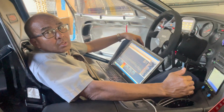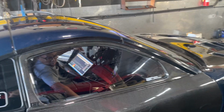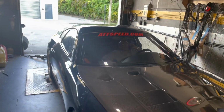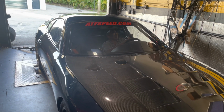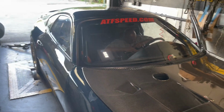Yeah, this big turbo is going to take some RPM to spool for sure. Before, our hardest launch previously on the 8685 was 4,700 RPMs. Car on a 150 shot was like at 18 pounds of boost, and I got a 1.17 or 1.16 to the 60 foot. So now that was 5,100 RPMs, a couple hundred more than we've ever tried, and it only made 10 pounds of boost. But he also wasn't on it very long. That was very instant. I'm sure if you leave it in there banging and popping, it'll make a couple more pounds. But when we get to the track, I'll test it. The weather's also going to be a lot cooler at the track, so it'll probably make boost a lot easier. But we'll start cranking it up, 5,500 RPMs. Should get it to leave really nice.